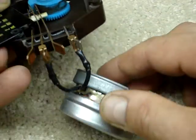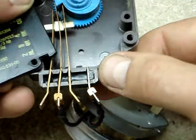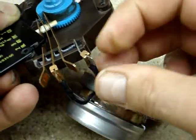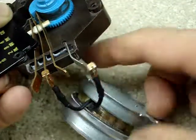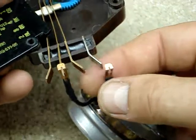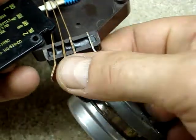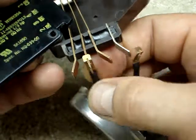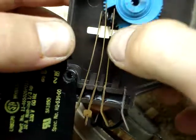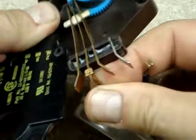So we look at the electrical leads. You can see that this lead goes nowhere — this is the power lead that goes to the little motor that runs the timer. Actually, that's the common. The hot power coming in is this one right here, the one in the middle of these leads. And I'll show you why that is.